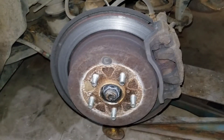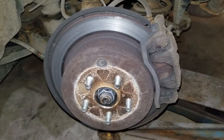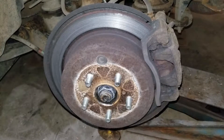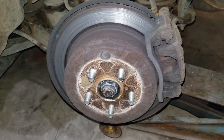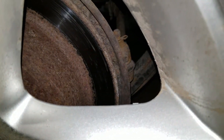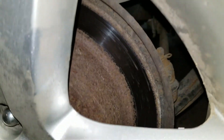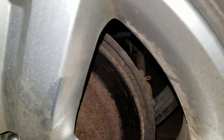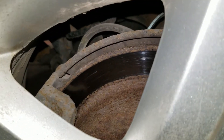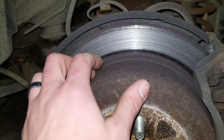Yeah, I'm actually impressed. This is a Subaru, and Subaru's all-wheel drive. But apparently the rear differential must lock in and out, so sometimes it's front wheel drive apparently. Because right now it's in park and I can spin this wheel over, which makes my job easier. So this is more what the rotor should look like — this one is smooth. It's still not great, it's an older rotor. Got new brakes to go on this thing. But this at least tells me there's nothing wrong on this side braking-wise, that everything's working the way it's supposed to over here. Now if I go to this other side — that's definitely not right.